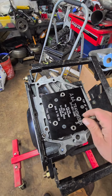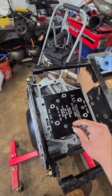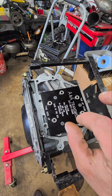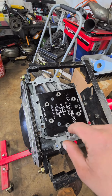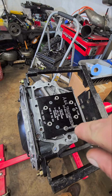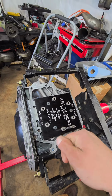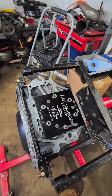And then basically, if you're going to be drilling and tapping your existing race instead of buying a $150 one that's already drilled and tapped, we're going to drill through the case, and then we're going to use the same drill bit to put just a little dimple into the steel sprag race. So you'll see how I'll go through the aluminum, and then it'll move a little bit more, and then it'll hit the sprag race, and then I just keep drilling for another 10 seconds. That way I can dimple where I've got to drill and tap the sprag race after I remove it.